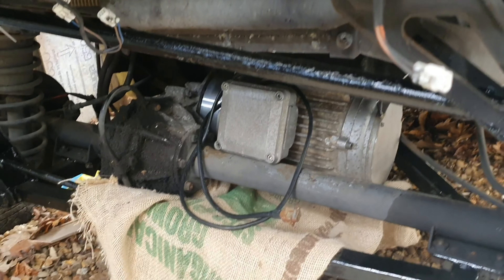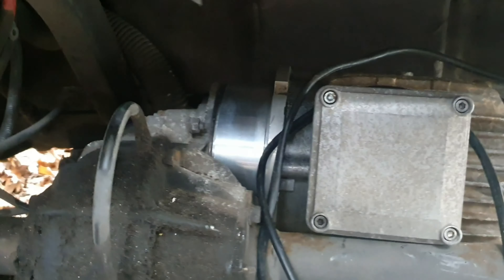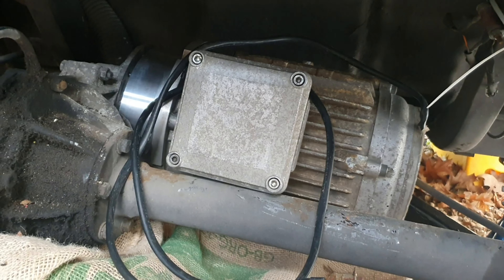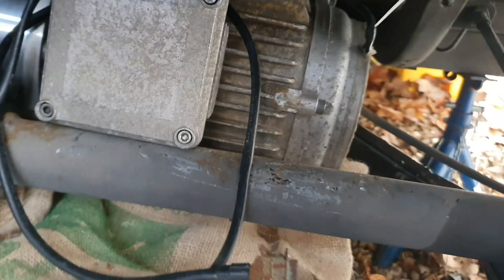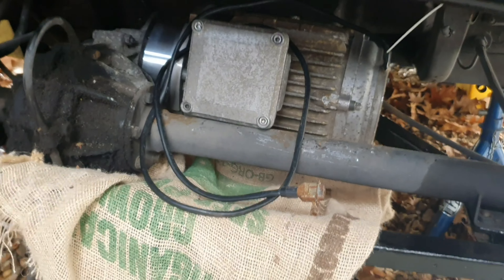I managed to get the motor behind there. I had to drop it off the suspension because it was too small a gap to go in there. I had to do the same with this side, but I've just put that one back up and the motor seems to fit in there quite well. There's a very small gap just at the back, but it just about clears that air vent, so there should be very little modification needed. I'm going to get the jack back up, put it under the motor to help get it bolted in, then put the support underneath — and that's the motor fitted into the car.